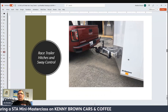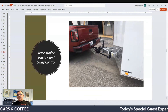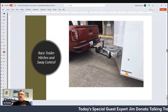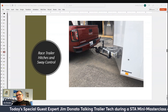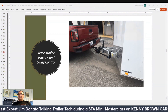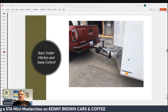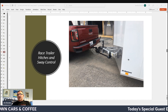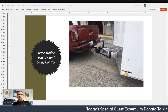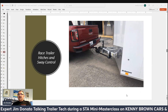This is called a Reese — a 66-550 Reese. The parts that attach to the trailer clamp onto the frame; no holes are drilled to the frame, which is what we recommend on all aluminum trailers. This device uses brake shoe material on the part hooked to the trailer, and the friction and sway control comes from the friction of the bar onto that brake shoe material surface attached to the trailer. That's a Reese system — a very good system.